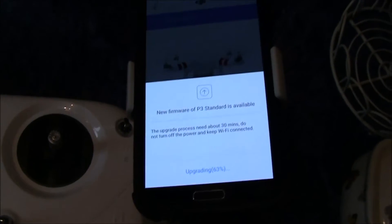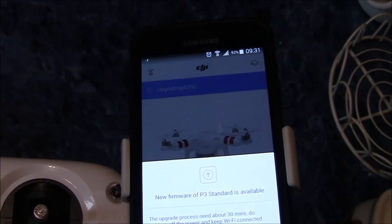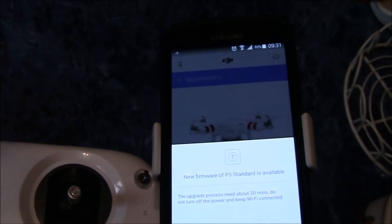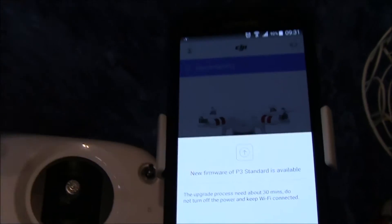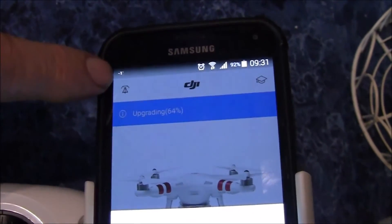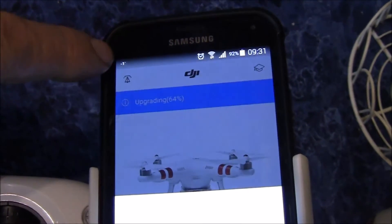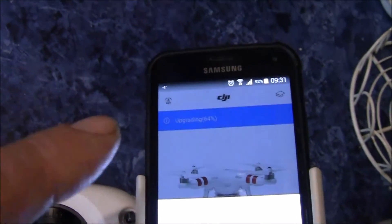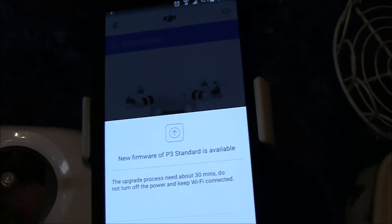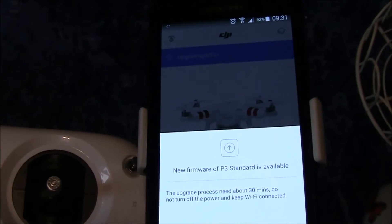To get the upgrade, go to your home button. When you're in your DJI mobile app, in the corner there's a little picture of a house — just some people don't know. Click on the home and it'll say download, and it'll say upgrade required or firmware update is required. Download it and it'll tell you how to do it. Follow the on-screen instructions then reconnect back to your Phantom 3.